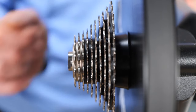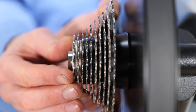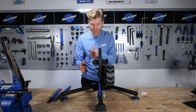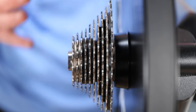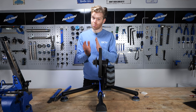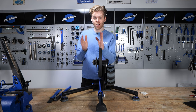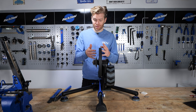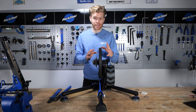What do we mean by this? It means that the position of the cassette will be slightly more inboard on either the bike or the trainer — slightly more moved that way. Not by much, usually only a millimeter or so. To solve this issue, we will take the cassette which is spaced more inboard and move it more outboard. That might be the cassette on your bike or it might be the cassette that's on your trainer. We'll show you how to try and work out which one it is in a minute.